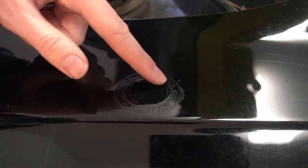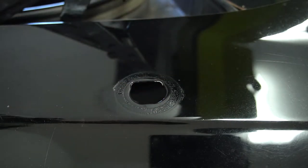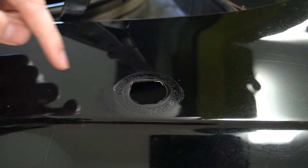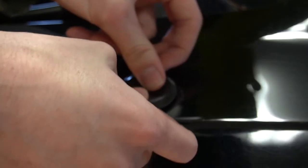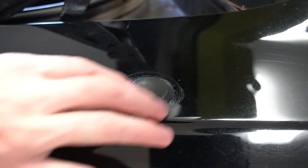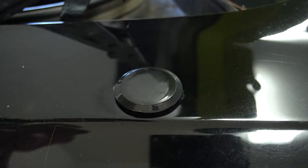As you can see, this side is flat and then it kind of rounds out. There's a nice big circle with orange-peeled paint underneath it where that antenna mast was — that's kind of our working area. Obviously the bigger cap is like the size of the mast but it can't go in the hole. The next biggest one — I believe this is the one-inch diameter — simple as that, it just pops in. Now is it watertight? I don't know, I'll have to test that. I'm trying to make this as small as possible, but we'll worry about the water later.